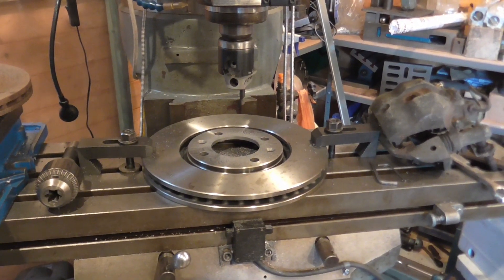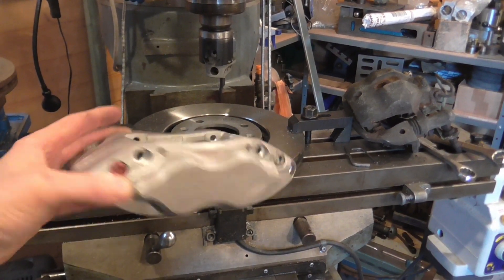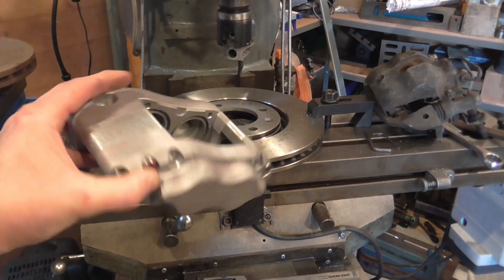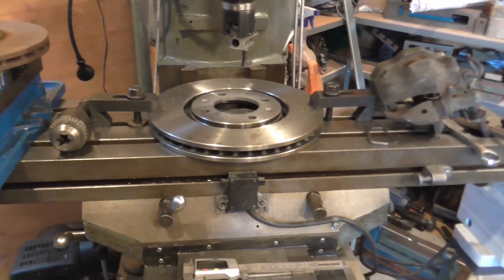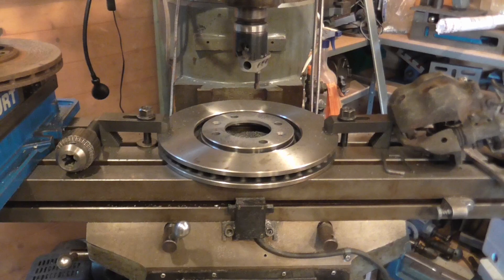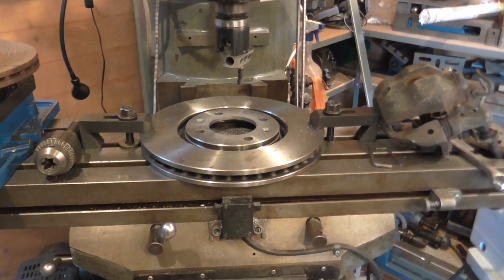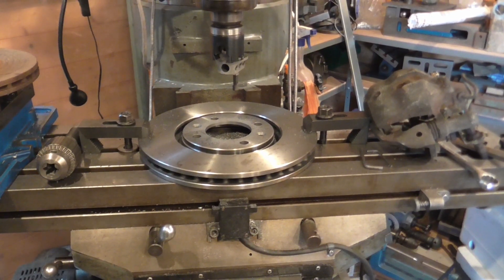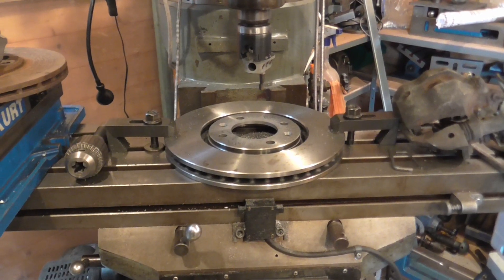I found what I thought were absolutely perfect — a set of High Spec billet 4-pot calipers. These were advertised on eBay as having been removed from a Peugeot 308, which as previously mentioned would have the same diameter and thickness disc. However, I suspect they actually came from a 306 and were using one of High Spec's aftermarket 285–288mm brake discs, which would be no problem.